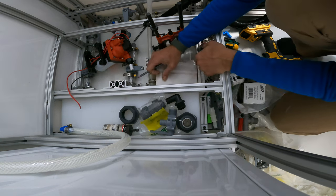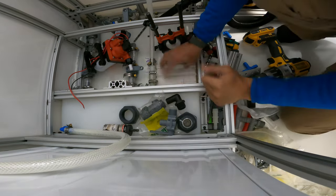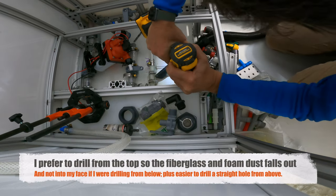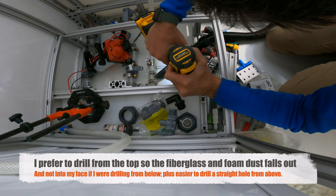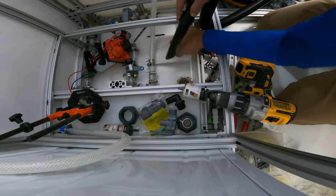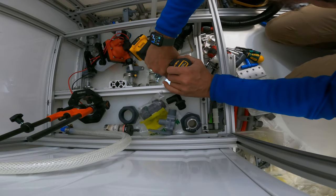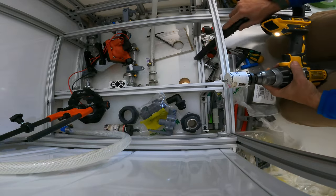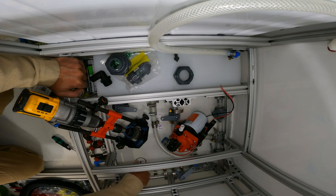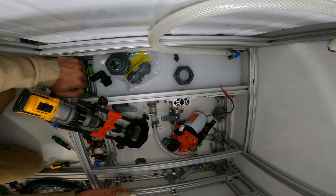I did make a change on the size of my through-hole connector and used a piece of scrap wood to become a guide for my new through-hole drill bit connection — so I could mark exactly where the old hole was, put a new larger hole saw into it, and drill out the old hole without any issue. That scrap wood became a guide for my new hole saw size. Another tip: I prefer to drill these holes starting from above all the way through, so all the dust and debris falls down below. The hole saws only go about two inches deep, so I drill through two inches, remove the foam and fiberglass surface, then continue drilling through with an extension to get all the way through. Then I pull that plug out and can continue.